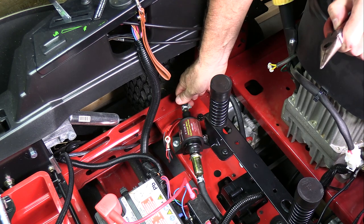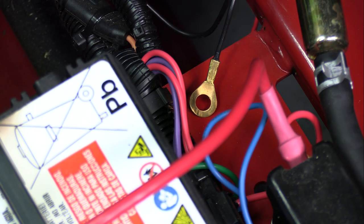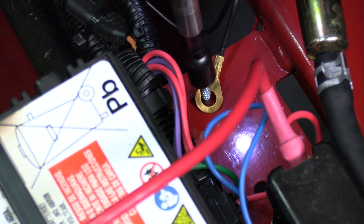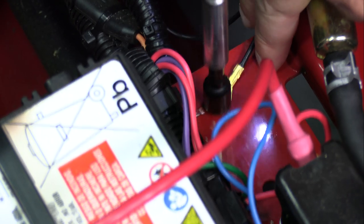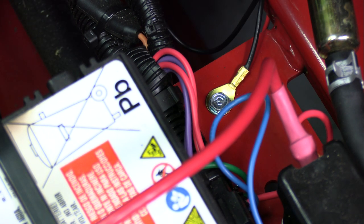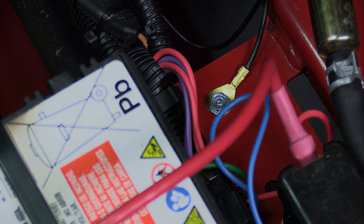Fuel is hooked up — now we've got to hook up the power. For the ground, you can just screw it right to the frame, again checking underneath to make sure it's clear. Make sure that's tight. I don't think you have to scratch the paint because the screw that you're putting through there is cutting through the metal and that's making good contact.